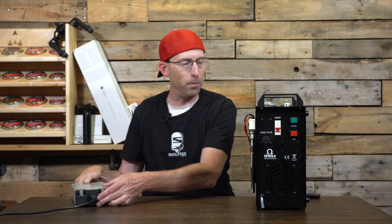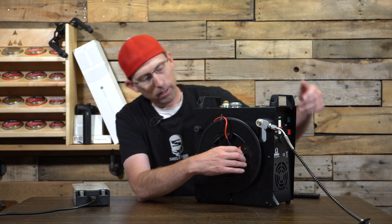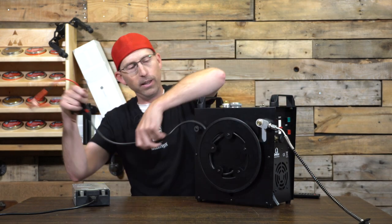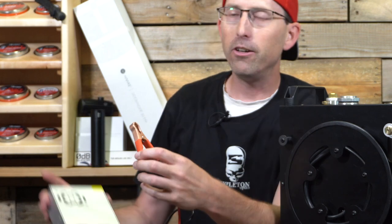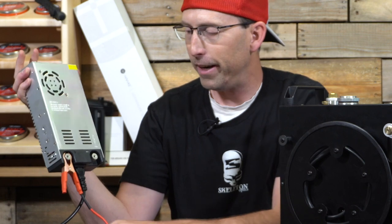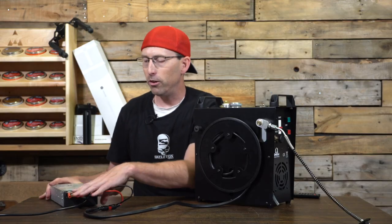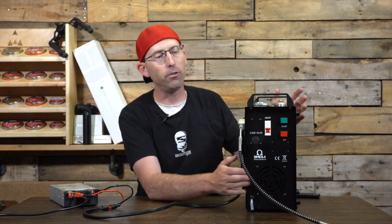To use it, it's really simple. First, unhook the hose and undo the alligator clips, then unwind the length of wire needed to reach the inverter — you only need to unwind the portion you need. The red alligator clip goes to the plus terminal, which is also slightly red on this inverter, and the black clip goes to the negative. Once connected, plug the inverter into your outlet, the fan will kick on, and you can turn the compressor on and run it.